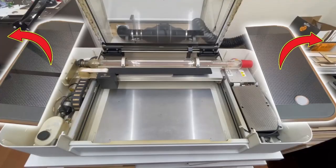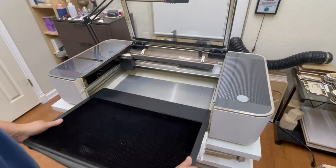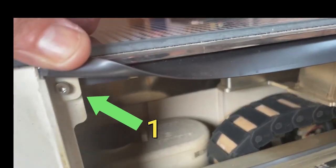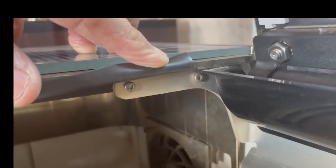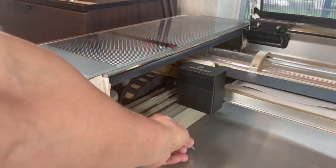I'm going to show you how to remove the top side panels. The first thing you need to do is remove your crumb tray, then locate the three screws that lock down the top panel to the frame. These screws are located underneath the rubber door seal on the front and the back. Using a number 10 torx bit, remove the three screws and set them aside.